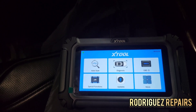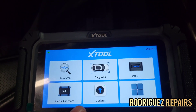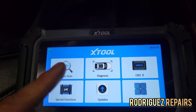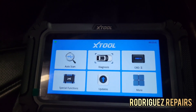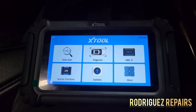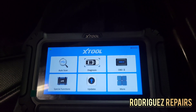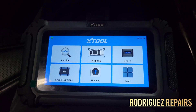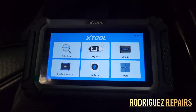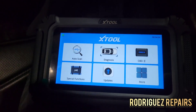Okay, so we got the tool connected. We haven't turned the ignition switch on yet. One good thing is that this tool charges on its own as soon as it's connected to the OBD2 port. You have about six things you can do here. First, there's the auto scan, which detects the vehicle automatically — this works better with late-model vehicles because they use a much faster communication network. All vehicles now use CAN communication compared to 10-15 years ago.